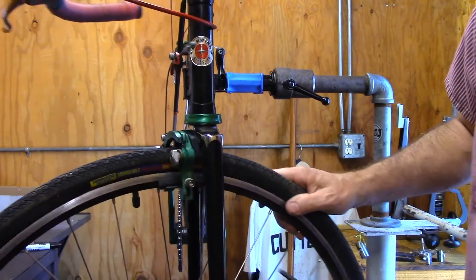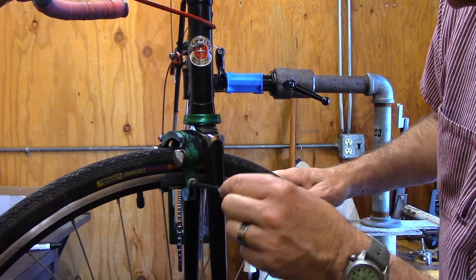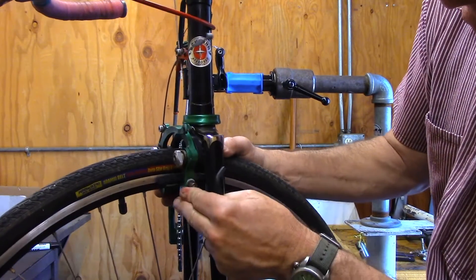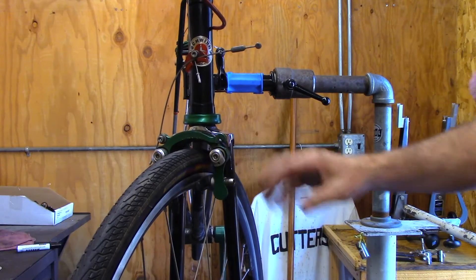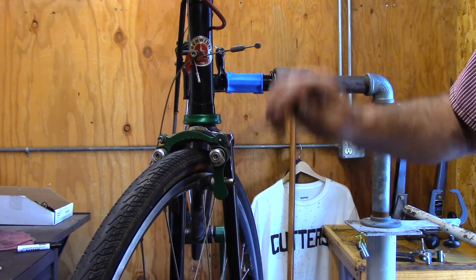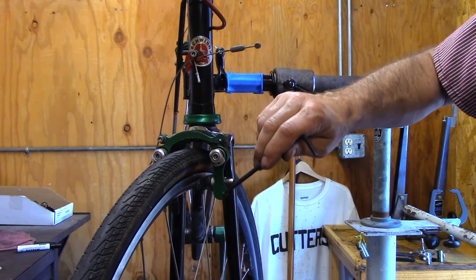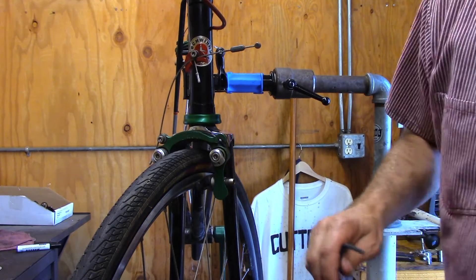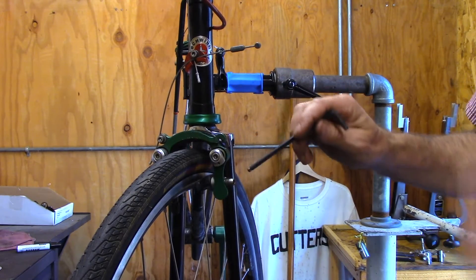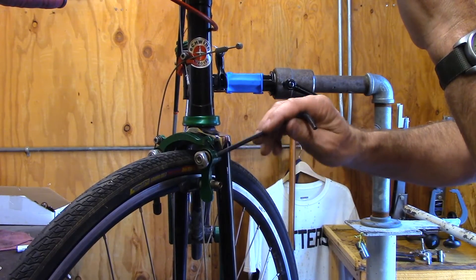Now, what we have here is a brake that we're up at the very top here, but it will work. Now, one thing about the racer brake is you can buy other brakes where you can do this conversion with really long arms, and they'll generally pivot up here, and then the arm goes way down here. And that becomes really flexy. And the cheaper you go, the more flexy they are. With our design, it's an old center pull design. You've got the pivot here, so this distance is very short, so there's very little room for flex.